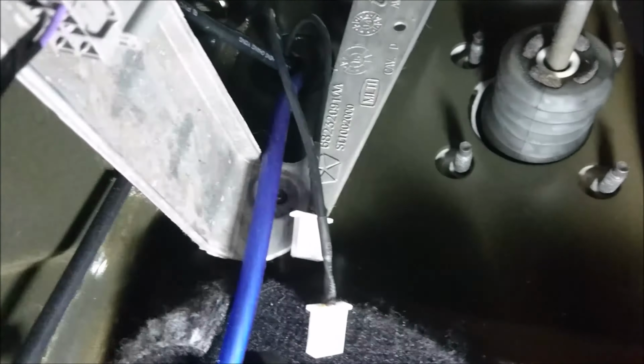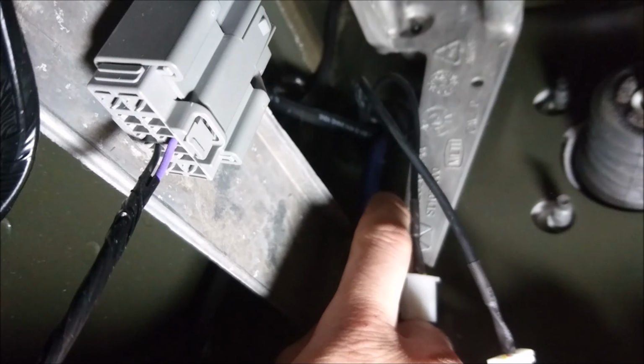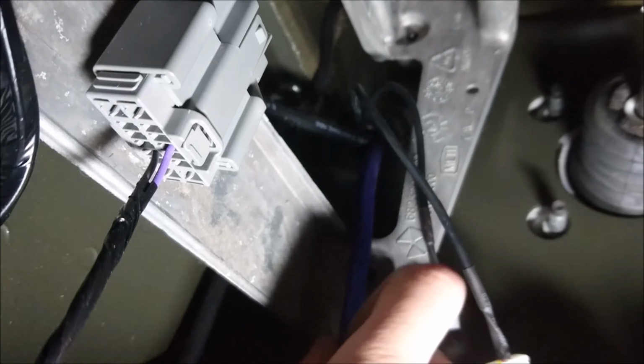But after it comes out through here, if you go in underneath where we put the stuff through, ta-da, our two pigtails will be hanging here. Let's see if I can, there, right there, and then up there, this is the part where they're all coming through. So, like I said, if you're having trouble trying to squeeze them through, you might need to come in here with a bit of an X-Acto or something and just open up the sleeve a little bit. Just be careful if there's any wires going through here that you don't catch it on anything or cut any wires. So once you get your wires here, find a path and just strap it up and along through here